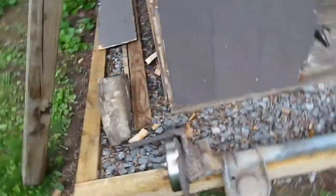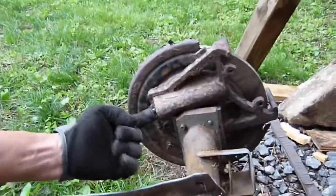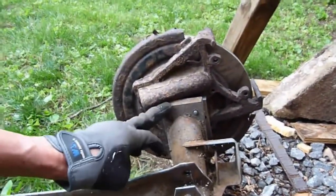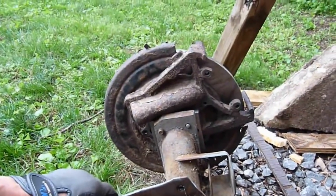There are a few little kinks. As you can see, this is where the emergency brake cable comes in. There's some interference here at the top of the axle. You can just grind that away and that'll take care of it.